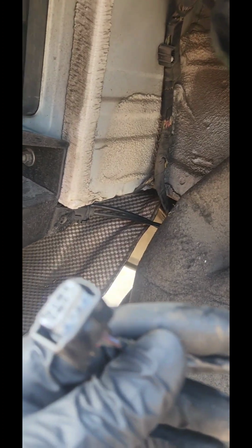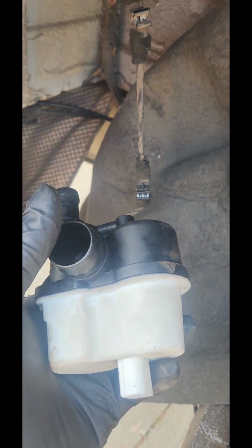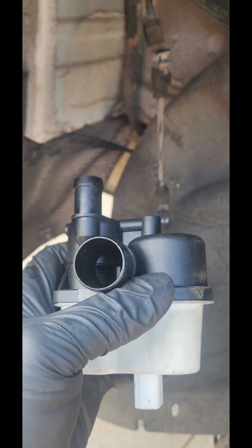It doesn't look green. Nothing like that. I'm sure there's not a wiring problem. It's going to be this thing, the DMTL pump, which is located on the passenger side, by the rear tire, where all these hoses are. So I'm going to grab a new one, put it in, and bolt everything back on.